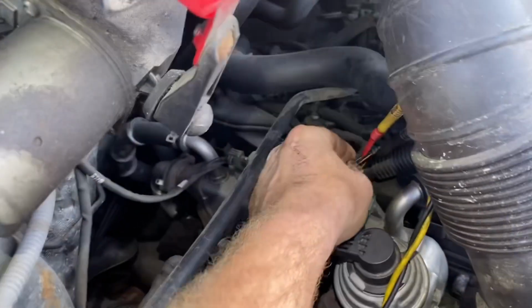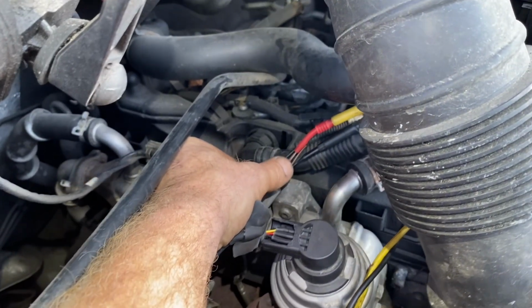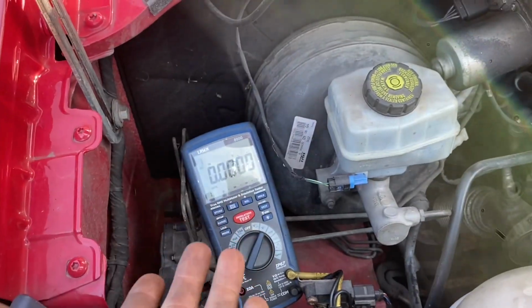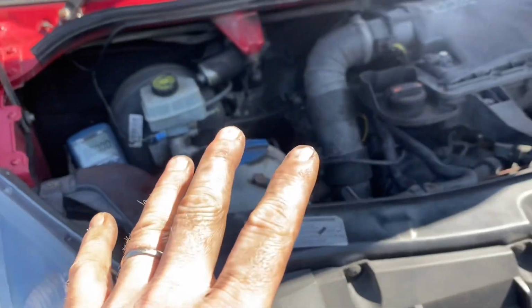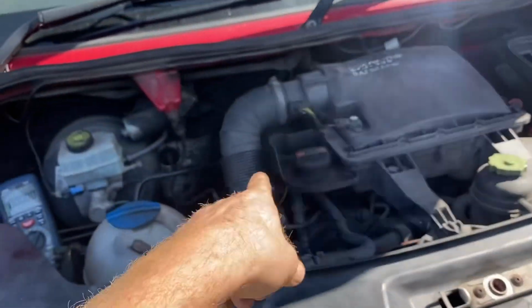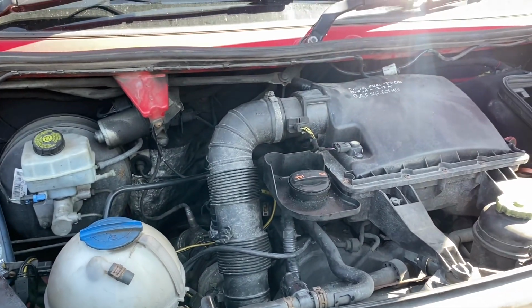Okay, I just got my second hand to disconnect, so I've unplugged the block connector, and between the ground and the signal wire I have 0 volts, so potentially it's going to be a pull up voltage. So it's at 0 and being pulled up and then up higher. But here's one option. The other option is, do I have a wire between my engine ECU and that position sensor broken, the signal wire broken? Right, I try and find out a bit more information and see where this engine ECU is.